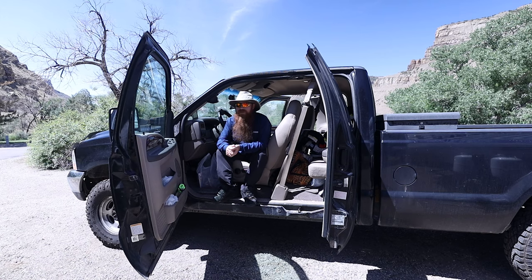I shut the truck off and turned it back on — same issue. I unplugged the trailer from the controller, played with the controller until it showed no connection, then plugged it back in, started the truck, and the issue went away. I don't want to keep fighting this controller or having these weird little problems. After talking with the parts guy and the service guy at the local dealership, they concluded it's my brake controller — and I agree. I just needed someone else to confirm it before I was willing to spend the money.